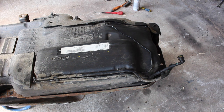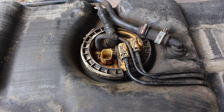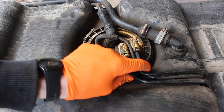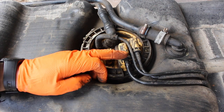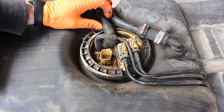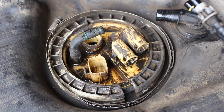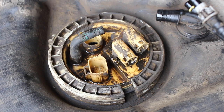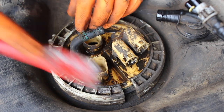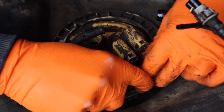With your six bolts released it should drop down relatively easily once you know that. Next step is to remove the five pipes that go onto the top of the pump housing. The three hard plastic ones are quite awkward — you'll need three little screwdrivers to press in the prongs and they'll pull out. One will pull off, one has a jubilee clip, and one has a quick connection. With all the pipes removed and the large jubilee clip loosened, the top cap can be loosened by hand and lifted up.